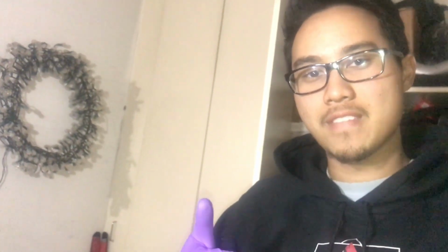And there's a perfect spot in this V-mount setup where I'm going to put it. I already started loosening things, and it looks like it'll perfectly go between those two radiator hoses. So I loosened it, I'm going to pull it out. Hopefully I bought the right size adapter, which I'll show you guys a better look at later. That way we can put the 1/8 NPT water temp sensor in line with the coolant radiator hoses. So excited. I love gauges.